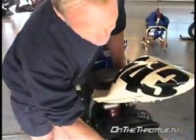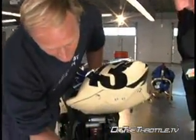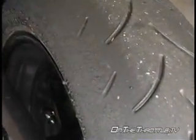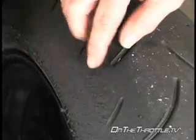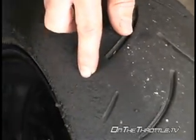We have two problems. We got a rebound problem, clear as day, because we've seen that all day long here. And here we have a cold tear problem. In some places it's worse because as the wheel rotates, there's load coming on and off. So this section is really bad. Now, when you're saying that one right there fits my nail right there, and it digs into the tire. Into the tire, right, and it's there.